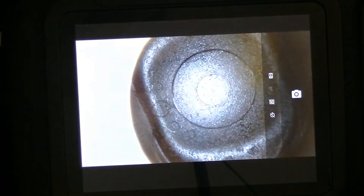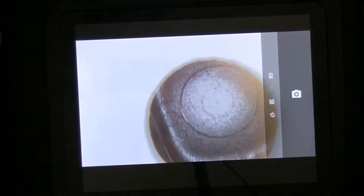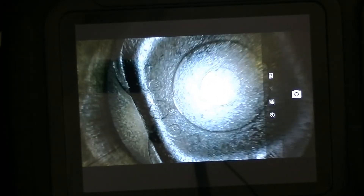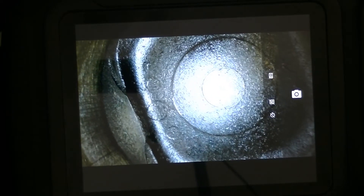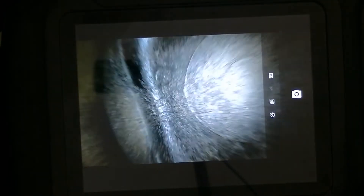You can actually see there is a very small amount of carbon buildup on the dome of the piston, but that is not anything I would call excessive. This looks pretty standard to me. So now let's go ahead into number two. Guide it down into the hole. This piston is actually pretty clean. Again, we can still see our cross hatch, but there is slight cylinder wall scoring. Most of that scoring is probably just from carbon buildup on the rings — that would probably wipe right off. I am actually pretty well surprised at the amount of cross hatch that is left. So let's go down into number three.